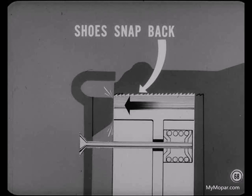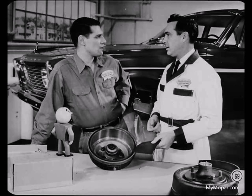If you run into this condition, the knocking noise will vary with car speed. The shoes may follow the threads and then snap back several times before the car stops. Do you have to grind the drums to get rid of the tool marks and correct the knocking noise? Normally, that's not necessary — just break up the machining pattern with emery cloth.